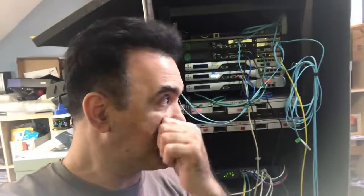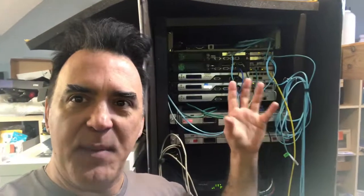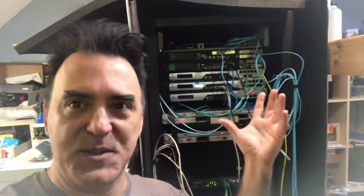Hello and welcome back to my playhouse. I just built a new 6-port 10 gig switch — that top box there — using an old Netscaler MPX 5500, which I upgraded to 8 cores and 8 gigs of RAM. It's probably a little bit of overkill, but it has a 300 watt power supply.